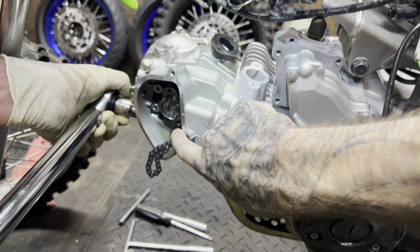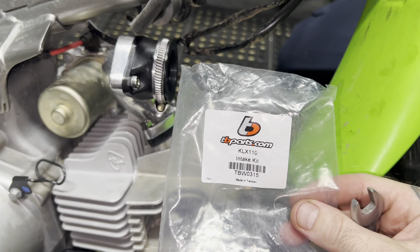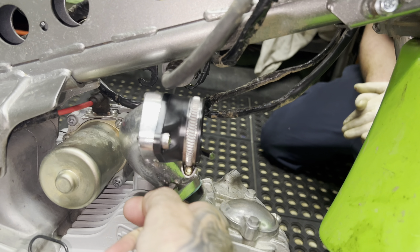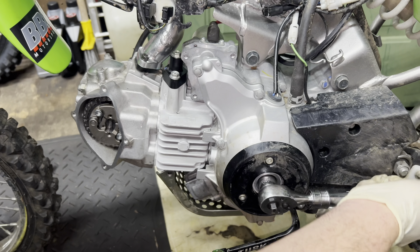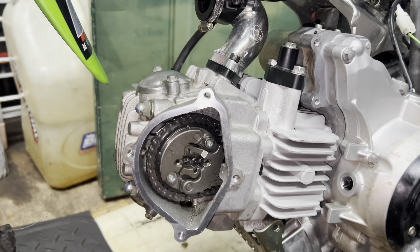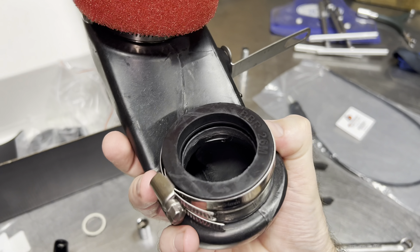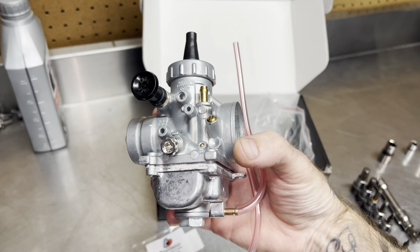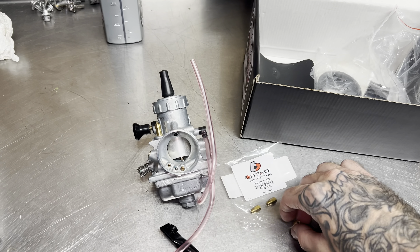You're going to want to make sure you're hand tight on the two 10mm bolts on the inside. We've got the intake manifold on — you're going to use stud on one side and the allen head on the other side, and just tighten that baby down. It's kind of a pain to get this in but you just have to work with it. Turn it over — he's on, timed up. Timing's on, turning over nice. Spark plug's in there too. Got the BBR U-flow in here with the 26mm attachment — make sure you don't over tighten these, you'll suck dirt because this is only plastic.